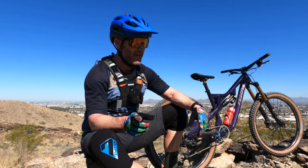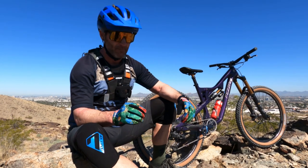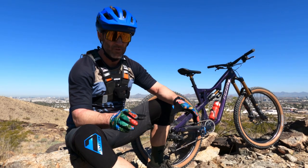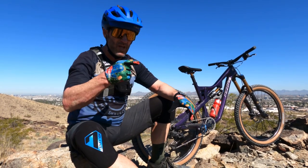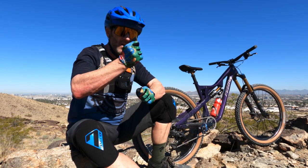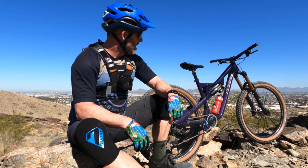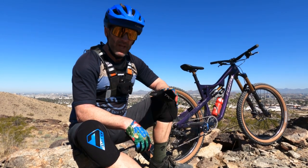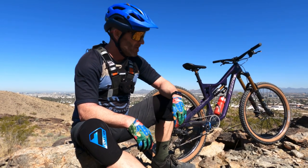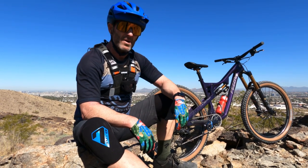So that being said, I wasn't sure yesterday. I was on the fence. Should I go large or should I go medium? I'm gonna stick with the large. But what we're gonna do is run an angled cup set and try to pull a degree of head tube angle out. So go from 64 to 65. I'll probably run like a 40, 45 mil stem, and I think that will get me where I want to be.